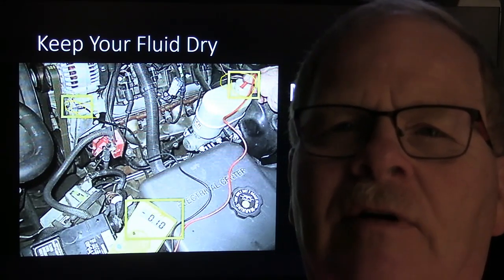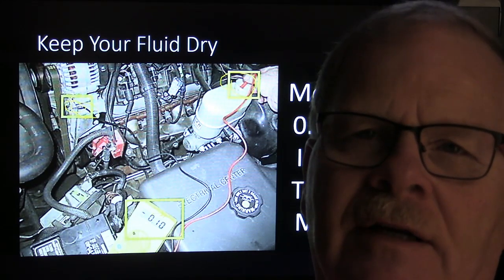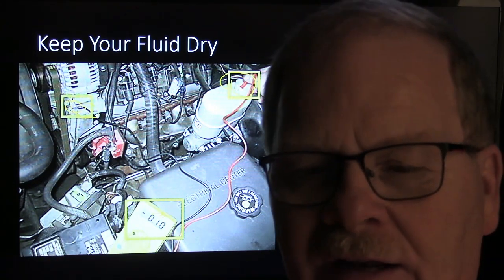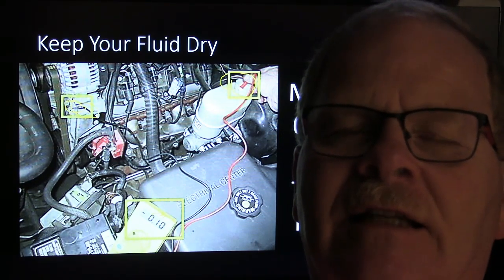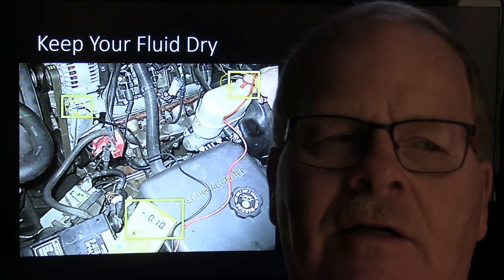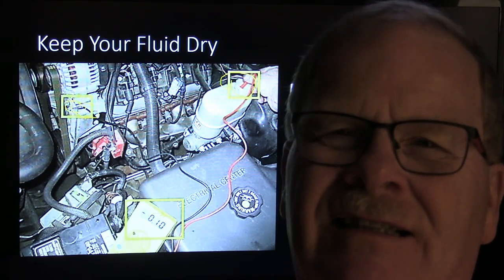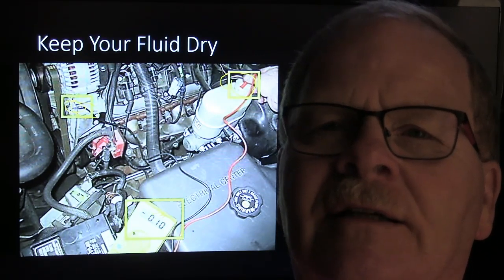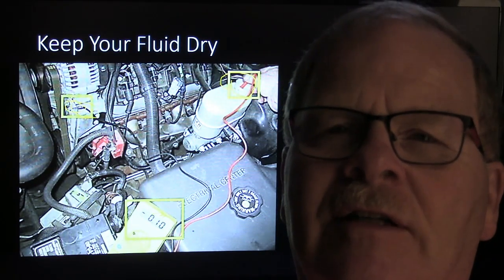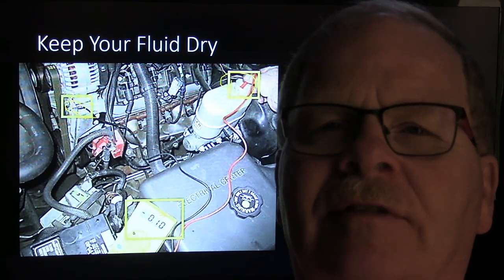I taught my students how to do that when I was teaching automotive. Interestingly enough, we never paid a lot of attention to this kind of stuff when I was working in the field. You can get into any area of automotive and dig as deep as you want to and find out all kinds of stuff. We basically just put on shoes and pads, built cylinders, and fixed brake fluid leaks. Some oil change places want to change the brake fluid, but except on Teslas and similar, there aren't any regular brake fluid change intervals, and most of the time we don't look at brake fluid. It'll be a dark color, and as long as nothing is leaking and the brake pedal feels okay, we don't pay a lot of attention to it.